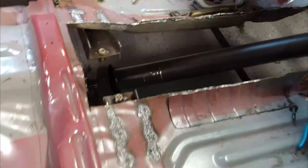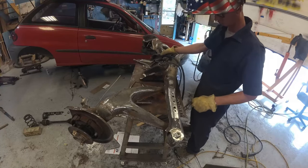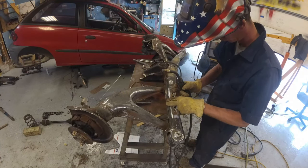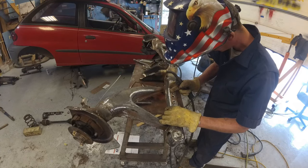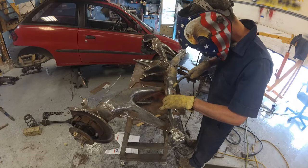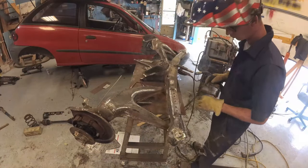The center support bearing on the two-piece shaft mount is not quite finished — I still want to add a little more bracing to it. I mount the BMW subframe a little differently than factory, and I was concerned about possibly crushing the subframe. So I added a plate, kind of like a giant plate washer, and then welded some bracing that goes down inside of it so it's not possible to crush it when I bolt it on through that subframe.